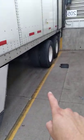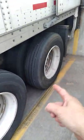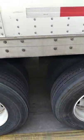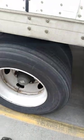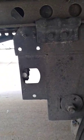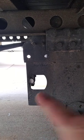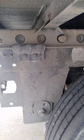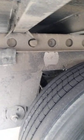Tandems — these guys right here — those are your back tandems, which are your two axles from your trailer. They want it to slide to the back. You can see right here there's little holes and a rail, and there's some pins right there. You press that button and this one works with air to release those pins.